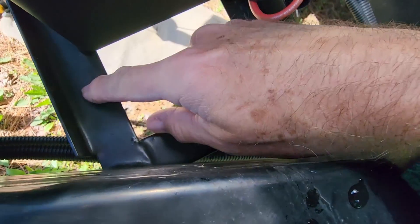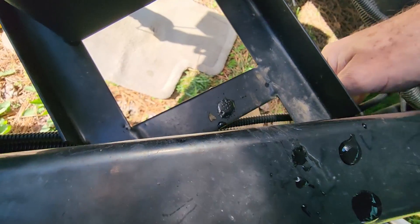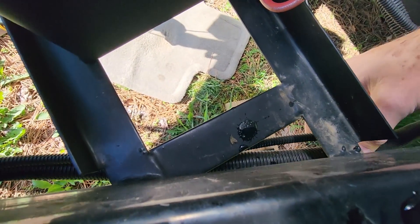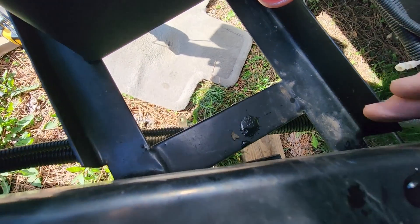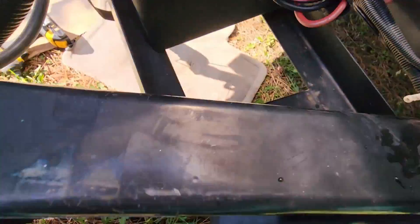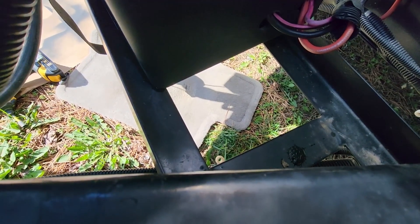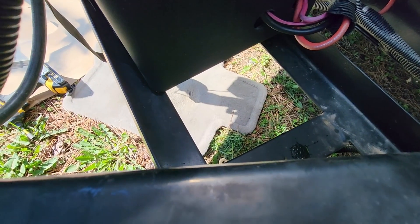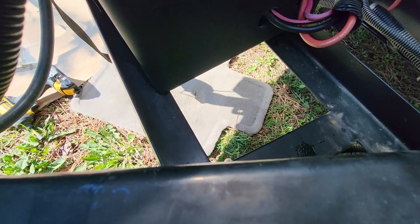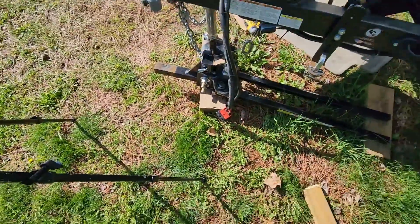This is my battery tray, and this wire bundle goes under the battery tray and along the bottom edge of the frame rail. If I can loosen it up at the front from wherever it terminates and bring it up over the top of the battery tray and into the tongue, that would be perfect — it would avoid any obstruction on the bottom side where the tire is going to be wanting to pinch up and ride. So next I need to look at rotating this battery 90 degrees.